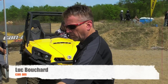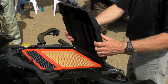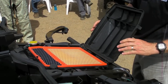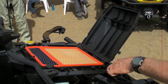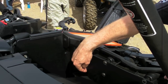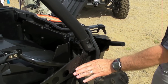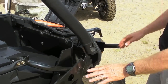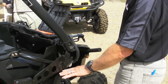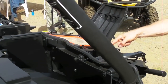For engine breathing, we go through the air intake of the vehicle. This is the airbox cover — you have the filter, but I want to draw your attention to where we breathe. We breathe behind the glove compartment at this height, which is pretty well the height of the cage. So if you are in water and start sucking water, it means you are about three and a half to four feet deep. This is the air we breathe through here.